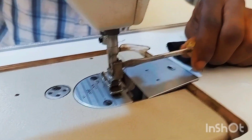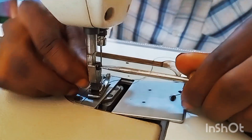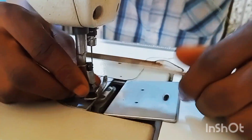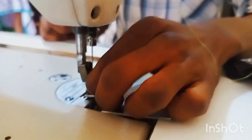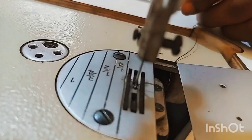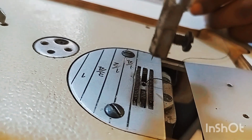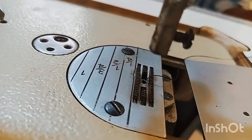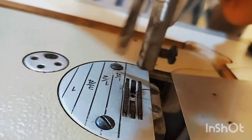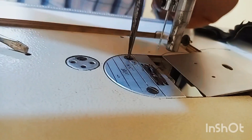Okay, let's begin. The issue is coming from the plate. First of all, remove the presser foot. It's coming from this place — the teeth and the plate — that's what's causing the squeezing. So I'm going to loosen out this plate and show you what exactly is wrong.